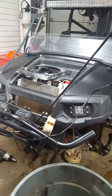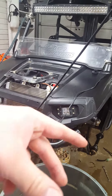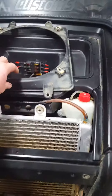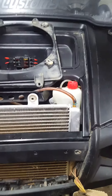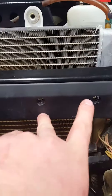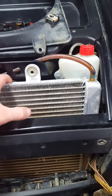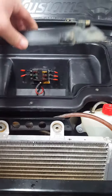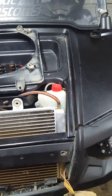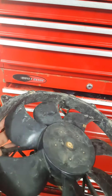Another thing I did is replace the fan. It felt like the bearings were going out, but when I took it out it felt fine — I went ahead and ordered a new one anyway. Getting the fan out is not easy. You can't go out either side — hoses on one side, the reservoir on the other. I had to take two bolts out, drill two holes to access them, pull the rectifier out, push the radiator as far up as I could, slide the shroud out from the top, and then yank the fan out. Not really looking forward to putting the new one in.